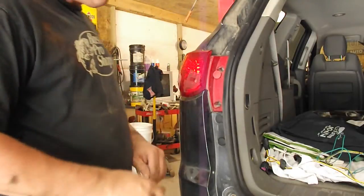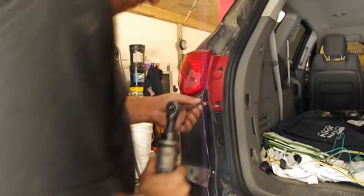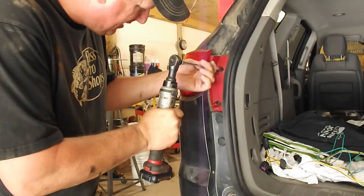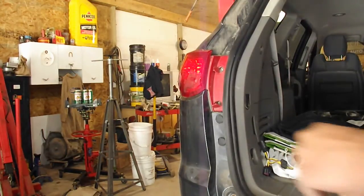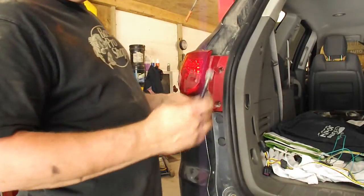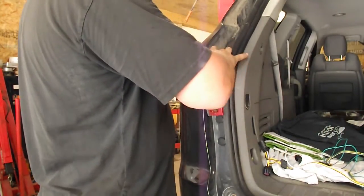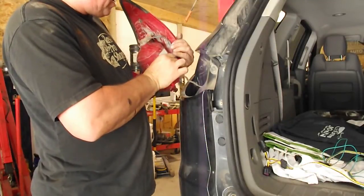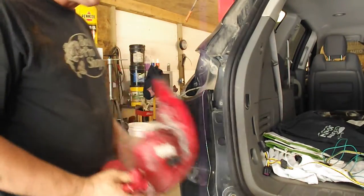There are two bolts in there — they look like they're 8mm but they're actually 7mm. Pull these two bolts out and the tail light should pull straight back. Use caution when removing the tail light because there's an alignment pin in the front of it. These are the only two fasteners that hold the tail light in place — you don't want to pull it outward or it'll break that tab. We'll pull the tail light out and unhook the connector right here by squeezing this tab. Sometimes you've really got to work with these things to get them apart. We'll set the tail light aside.